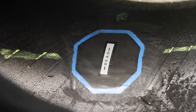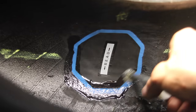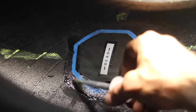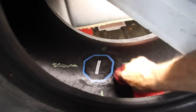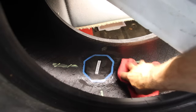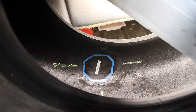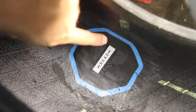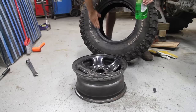If you're a pro tire repair shop, they're going to have some rubber stuff that goes around the edge to seal everything up — of course you're not going to have that on a trail. So I'm going to put a little bit more rubber cement around the edge. You don't have to, but what's it going to hurt? The last thing I want to do is remove all the debris down in here so it doesn't get stuck in your valve core.